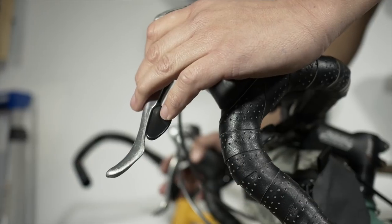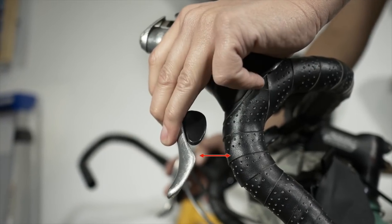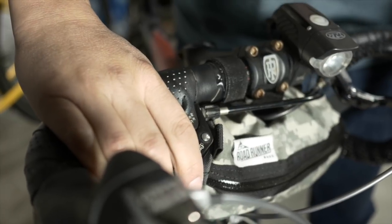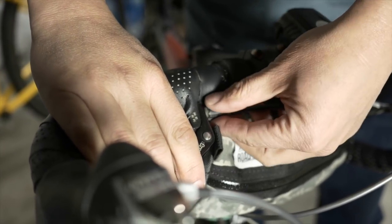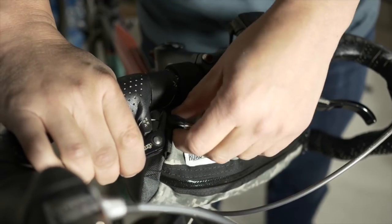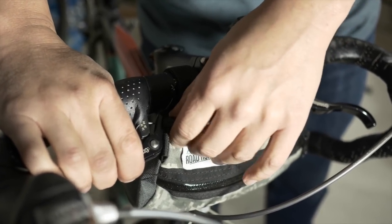Next, check the B's which stands for brakes and bars. Squeeze the levers and make sure you have about half an inch to an inch gap between the handlebar and the lever once compressed. The way I remember how to adjust the barrel adjusters is to follow the cable towards the brake and turn them counterclockwise. Another way is to compress your levers and turn the barrel adjusters — you should actually feel the levers expand or compress with every turn.